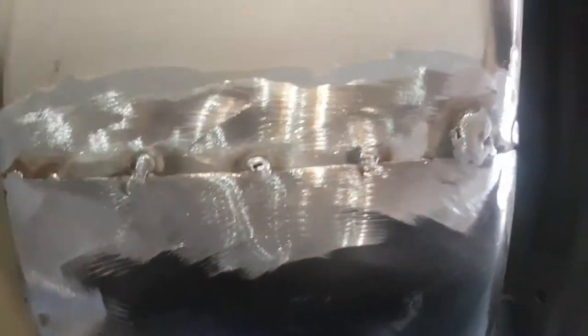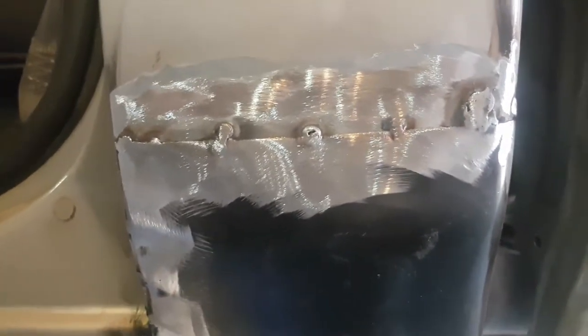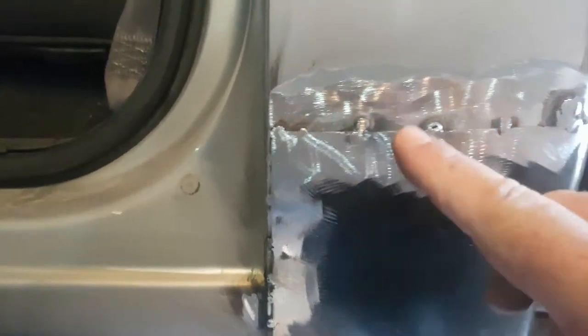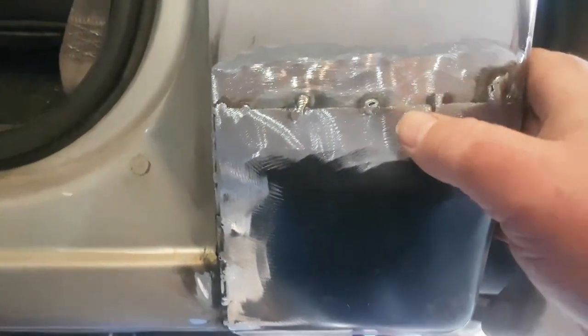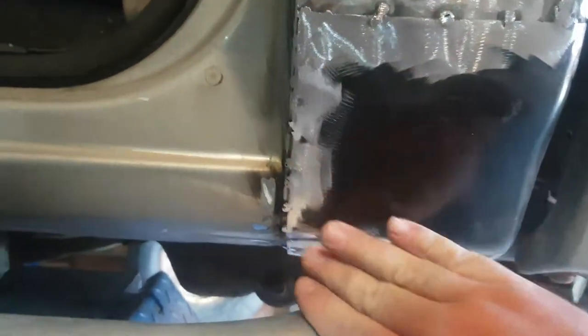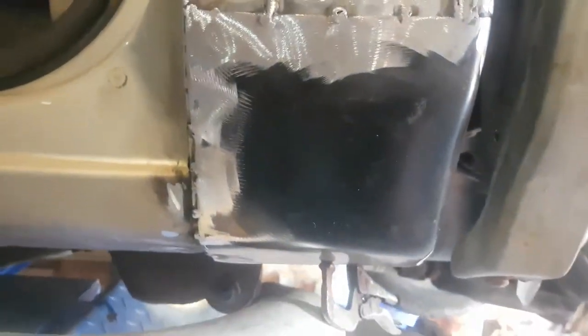Some people would just fill the gaps and it would probably hold up, but personally I like to weld in any outside edges exposed to the elements — weld it up solid. Then you can clean it back up and there's less chance of it breaking out. It's an old truck, it's rusty, this isn't going to last forever — but it could last a long time if it's kept undercoated. With MIG welding, the point is don't weld any more than an inch at a time. The heat will pull or push the metal. Ideally, keep the heat as low as possible. Fill in the gaps, weld it in, and grind it off — it'll look like a piece of the truck.